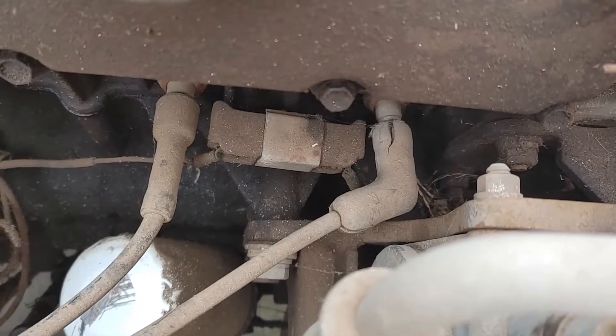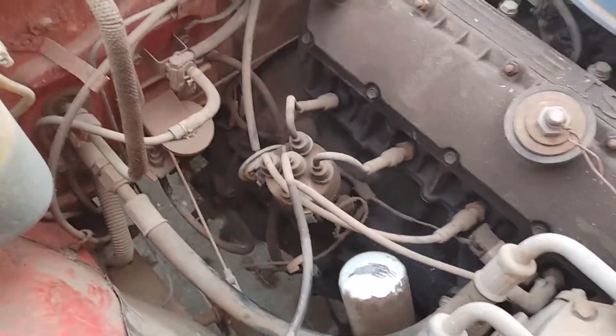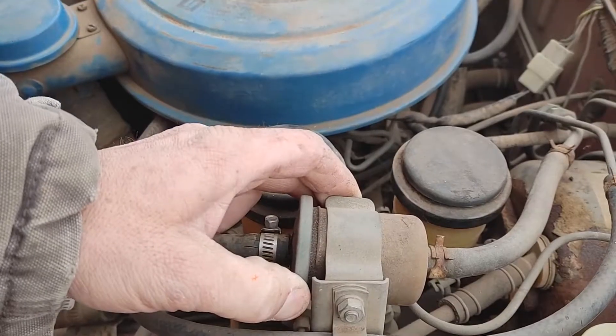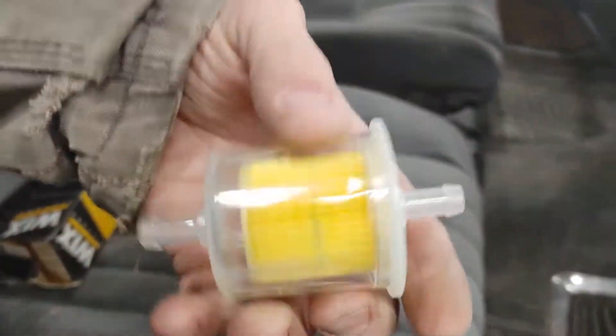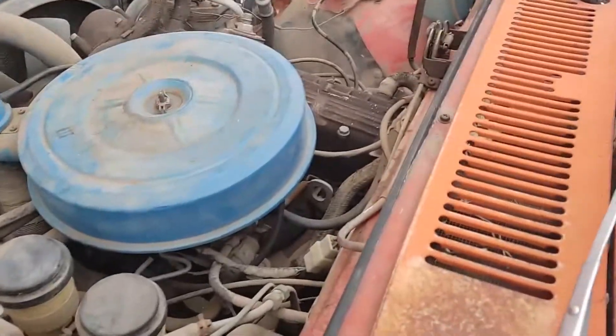One thing I do know — that spark plug boot's not very freaking good. What are these spark plug wires? That ought to be the cheapest set ever. Look how short those are. Stinky gas. I think I have a spare fuel filter. Let's just spray some brake clean in this and see if we can get her running on that old stinky gas. You can smell it — it's bad gas.